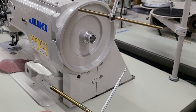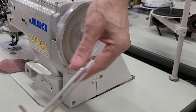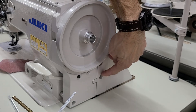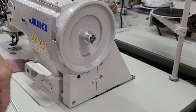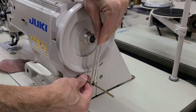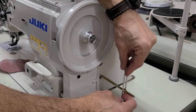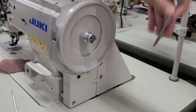There are two different spots on the machine that we could use. We could remove this screw from the belt guard here and install this one in here, or we can move this screw from the belt guard and install this here. It's up to you, it doesn't matter. For this video I'm going to remove this one, but if I sent you the other one, you're going to take the shorter end and go here; with this one we're going to take the longer end and go here. I'm going to grab a screwdriver and remove this.